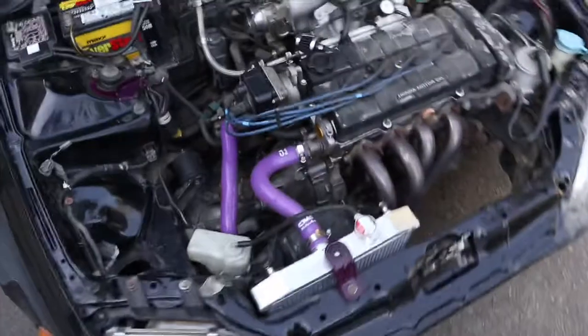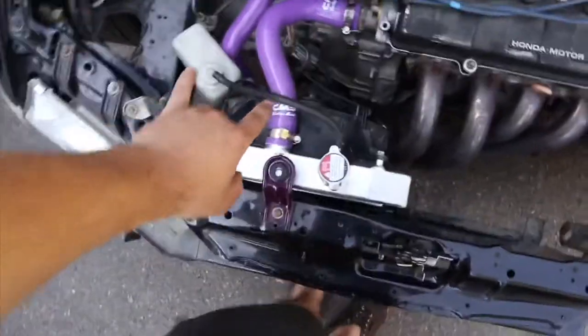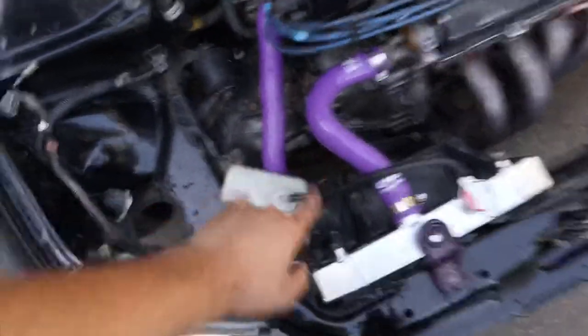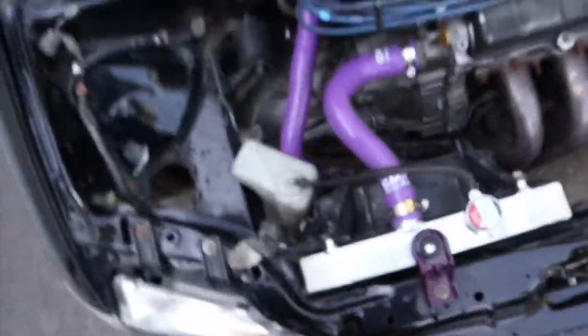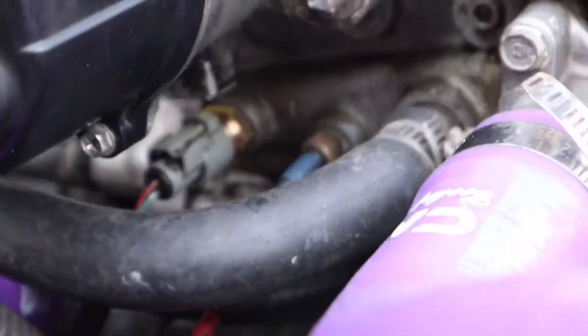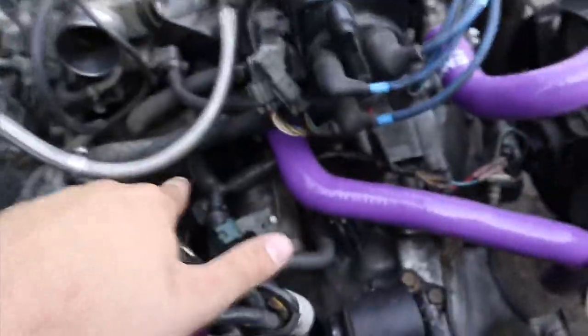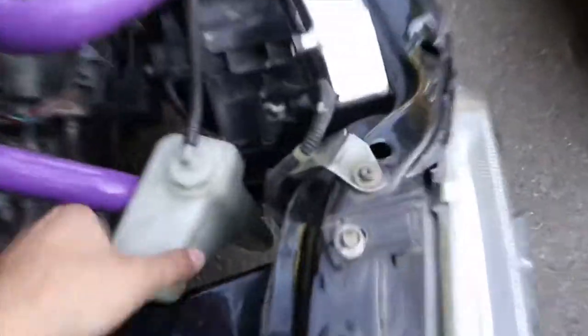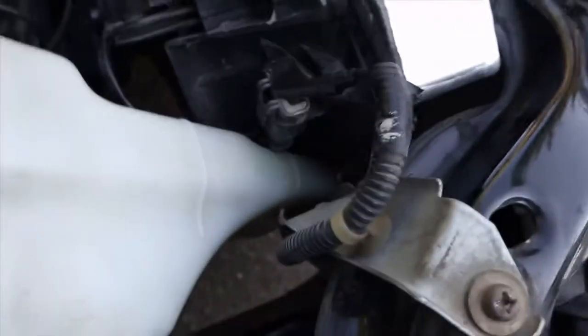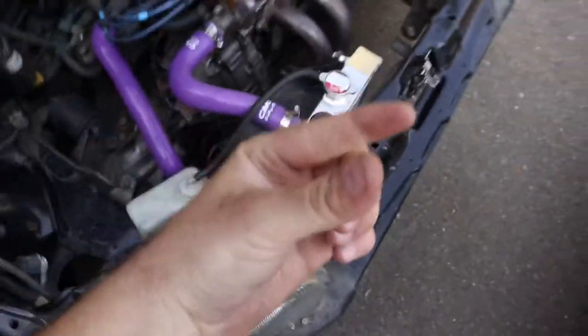I think our new cooling system is ready to go. Little recap: we got the all-aluminum dual core rad, followed up by the two main hoses — the upper and lower from Cooling Masters, actually a decent purple hose. We went ahead and replaced that temperature sensor — you can see it looks brand new. We also replaced the thermostat with the Gates Racing 170-degree thermostat, stock fan and shroud, and I wired it myself. The cooling overflow bottle doesn't fit in there anymore, so there's still a little more to sort out before we can drive it.